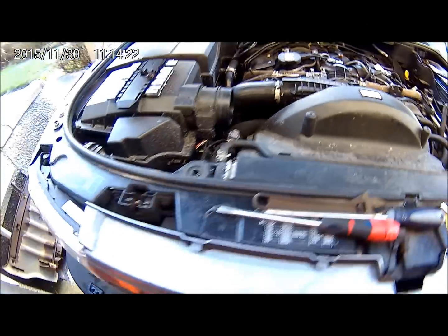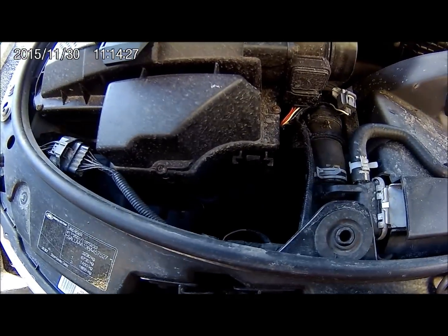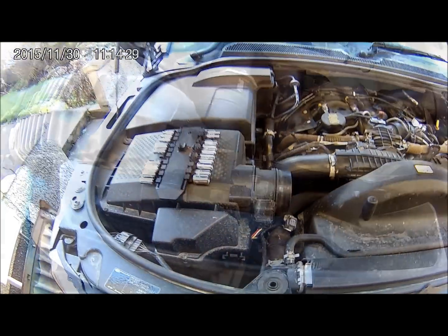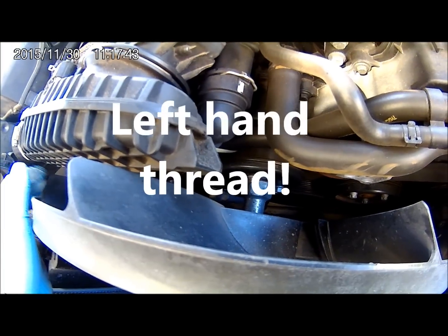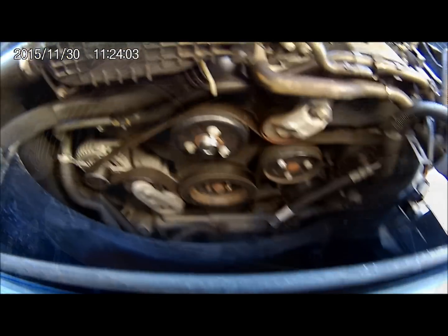Another little tip: when you take your nuts and bolts off, don't be tempted to set them on the bonnet landing panel — as I've just done, I've just knocked a couple down there. I've done this off before when I changed the alternator, so I know it's going to come off. It is a left-handed thread, so it's easy to work. Fan out the way, unplugged and removed.